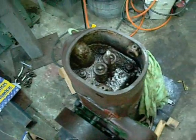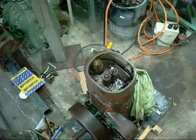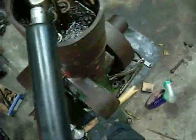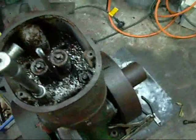Let's get these head nuts undone and lift the head off. The bore has been full of heating oil for a while now, so it might do something to break the rust free. One more head nut to go — it's free, it just makes a hell of a racket. Just got to work them back and forth, see if I can get that spray into them. It worked — one stud came out but the nut is loose on it, just binding up at the end. It's going to come off.